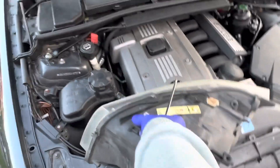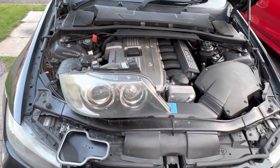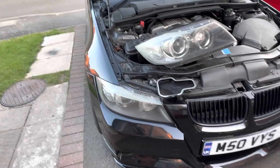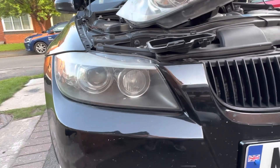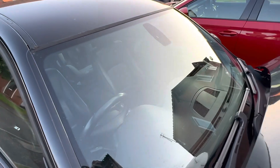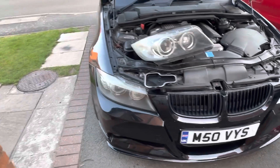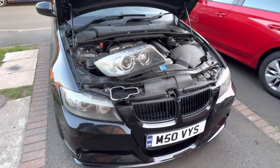I really hope this information helps someone who was in the same situation. If you're watching this and have different headlights, please let me know in the comments whether yours are switchable or not. I've since replaced these lights because the lenses were getting cloudy, and rather than just replacing the lenses I upgraded to dynamic LCI Xenons. That meant changing the light control module, the FRM, doing additional wiring and coding, and changing the rear-view mirror unit because it contains a camera which is part of the mirror assembly for the high-beam assist. I can confirm that LCI dynamic Xenons for the E90 or E91 are non-switchable.